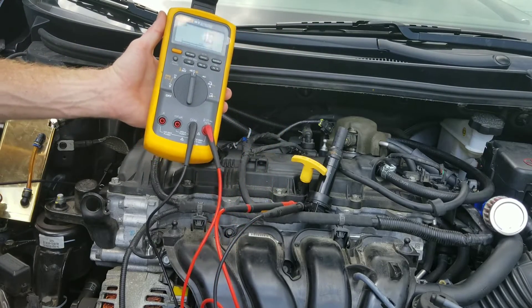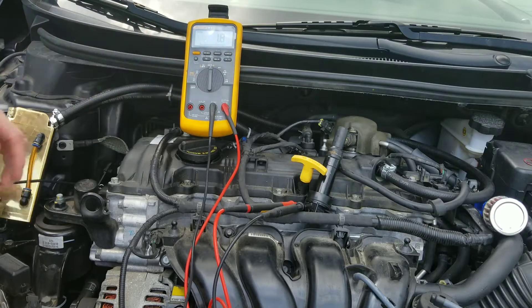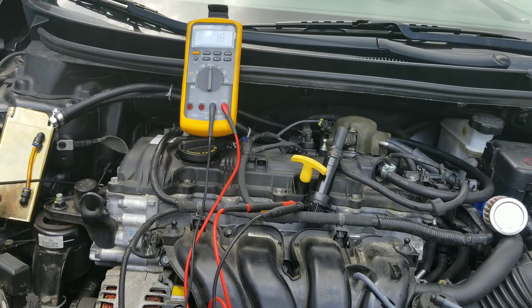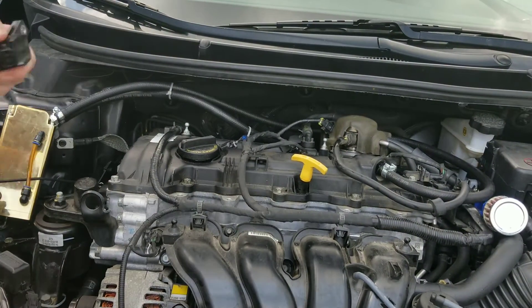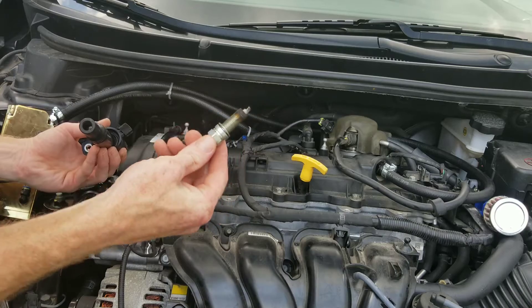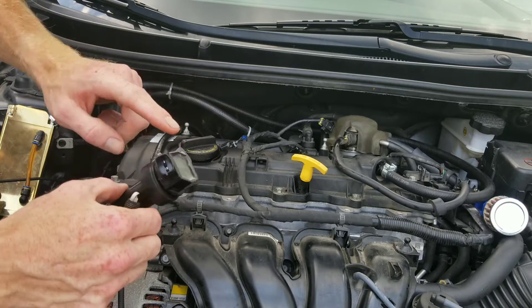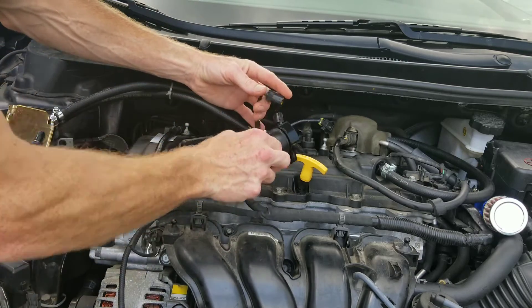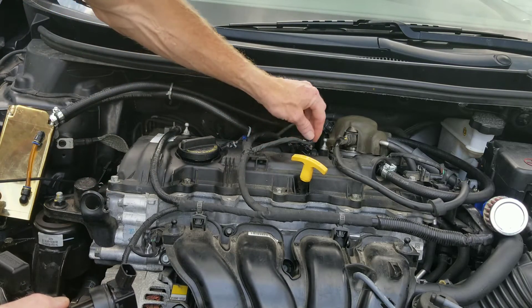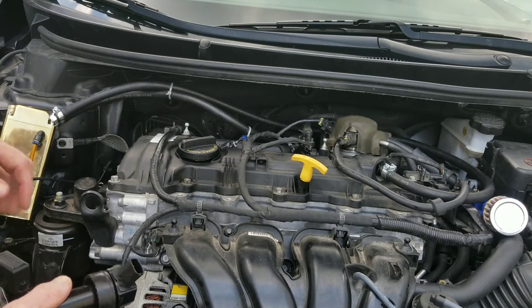For the temperature and everything, it's just right. Now I want to show you guys the next tool tip — a quick test. Take your spark plug and your spark plug hole. You'll need to connect your connector back up to this, so I would connect my connector back up. Then I would take a fuel pump fuse out, or just unclip one of my fuel injector clips for each cylinder for this test.